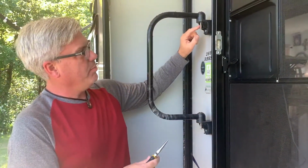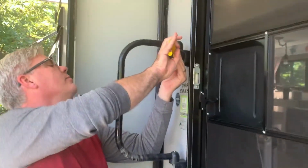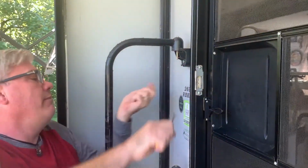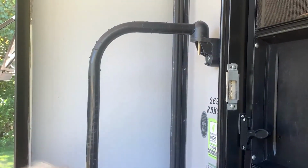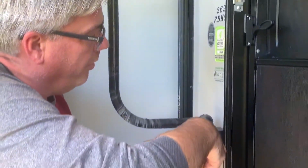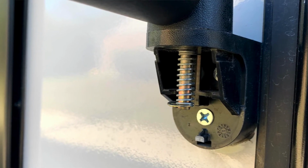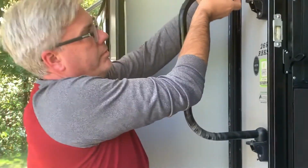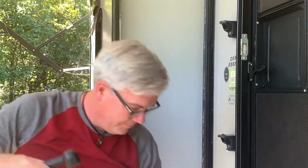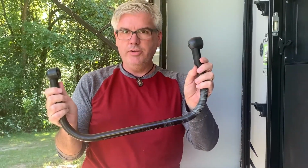Now the next thing is we have to pull the spring pin out. So there's a little bracket on here. I'm just gonna use some needle nose pliers to pull that off, and make sure you don't lose the spring because it's gonna go flying. And I'm gonna go ahead and take the bottom one off also. And now these pins will come out. Nice. And the whole handlebar comes off. Now we already removed the handlebar tape that we had on here, but you're gonna wanna clean this bar up pretty well so you can get the new stuff on.